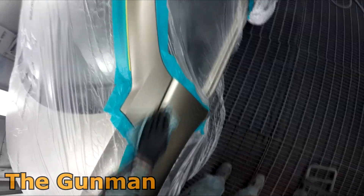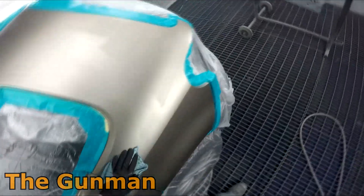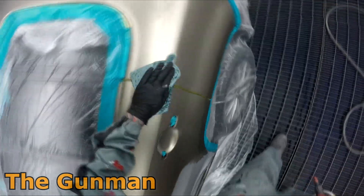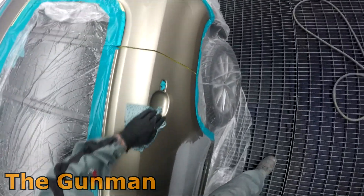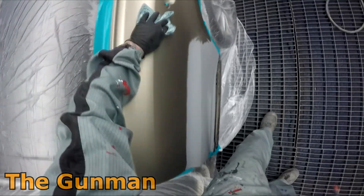You can see I've got all my masking done. I'm now wiping the entire thing down with wax and grease remover and one of those Polytex cloths - they are supposedly lint-free. These probably aren't one of my favorites on the market, but I can still get some good results. I find that if there's any bits that you back mask around door handles and stuff like that, there will be a little bit of lint. But a good blow-off and tack rag, and as long as you're aware of it, it's all good.